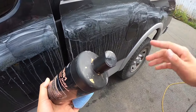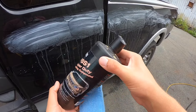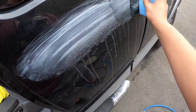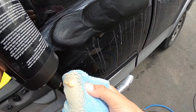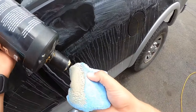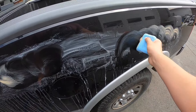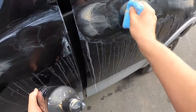Once you've finished wet sanding the whole scratch out nice and thoroughly, you want to use some heavy cut polish — something that would remove around a thousand grit worth of scratches, so fairly coarse. Apply some to an applicator pad or a cloth and apply it to the scratch. You can also apply a little bit to the polisher as well, but if you apply too much it'll end up making a mess and going all over the vehicle, the ground, and your clothes. Then you polish it in.